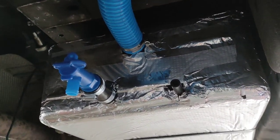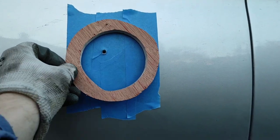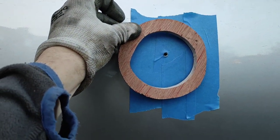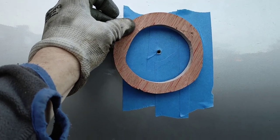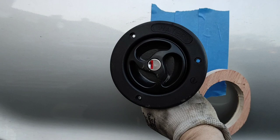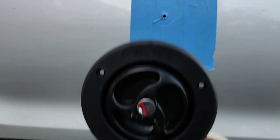I think I need to go and do the fill port next. Here's the location for the water fill point which I'm going to cut the hole for now. I've made a plywood template — it's a bit rough but it'll do — which is also going to work as my backing ring to give it something more to screw into. I need to put a bit more masking tape on and mark out the inner ring which is the bit I'm going to cut out. Then I'll line up, make sure the fill port fits, drill out the three holes, put mastic on the back edge, stick it in place, and use some black sealant to make sure it's double, triple waterproof. It should be a pretty reasonable job — nothing scarier than the roof vents or windows I've already put in.